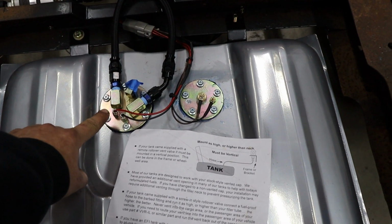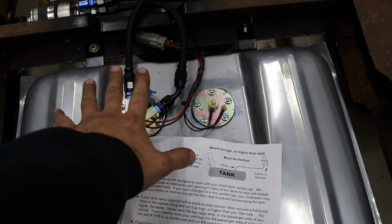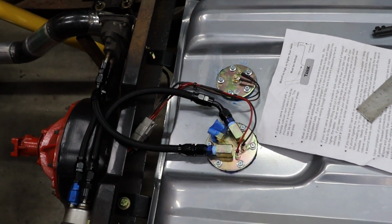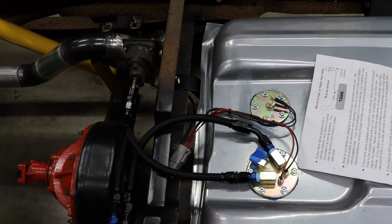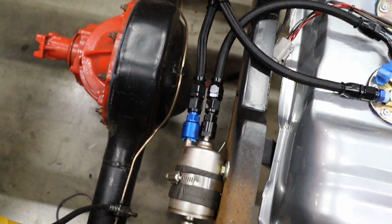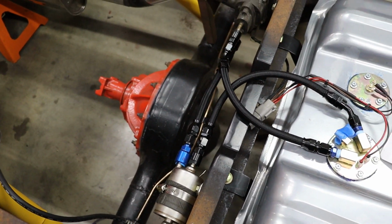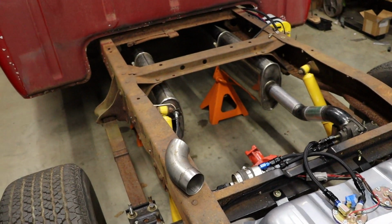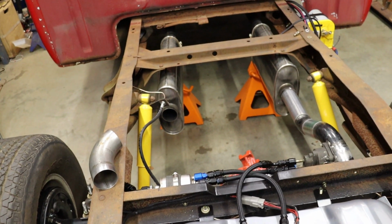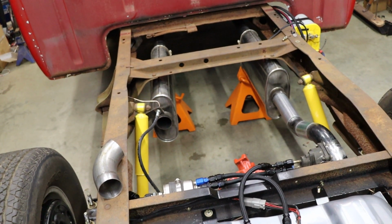They had the internal fuel pump set up and the fuel sender already figured out. There was a whole bunch of R&D that we had to put into that. We could just literally buy the tank and drop it in, which was super nice. We're running a flex fuel sensor, of course, and a Corvette style filter regulator, all PTFE fuel lines. We're using the original exhaust off of my Studebaker when it had the LS in it. It's remarkable how similar the truck sounds to my Studebaker.